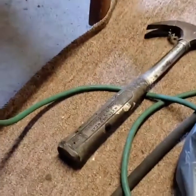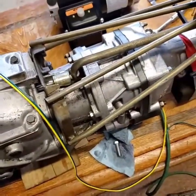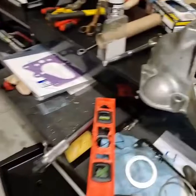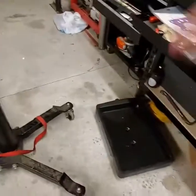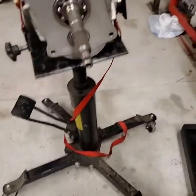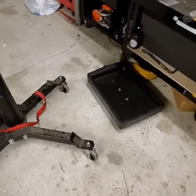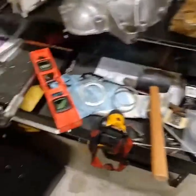There's that wreck. I kind of expected it, but it's all good. Doing this is relatively easy up here; back here is going to suck because I have to undo all that all over again. I have the bell housing gasket — I thought it was the intermediate section which goes on the back, but that's not the case. It is the bell housing gasket. Once I get my intermediate section gasket in, I'm going to have to recalculate all my shims and everything. I may have done my shim calculation wrong the first time. I'm kind of tired of dealing with it, but I ain't going to stop until this thing gets back on the road.